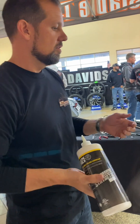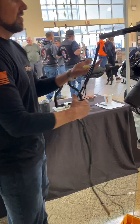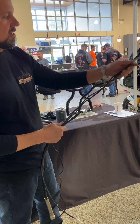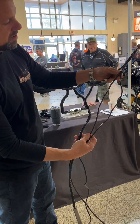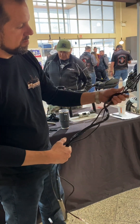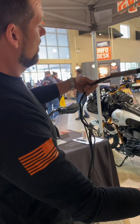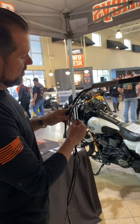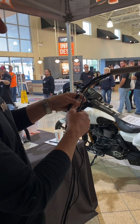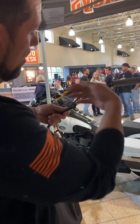You can get this lube at Home Depot. I'm going to coat these, and notice how I leave everything loose? This is so we can individually pull the wires through at the end when they come out that center hole. The other important part is you want to keep these wires uniform the whole way through. Instead of just letting them get all bunched up, try to keep them so that they're going in line, in order — not all kind of crisscrossing.